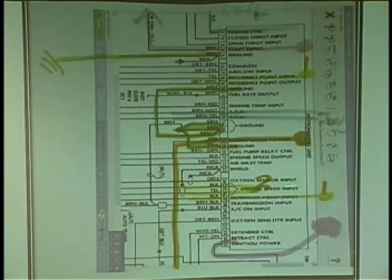Now if you wanted to, you could also highlight the crank sensor and cam sensor. I use yellow for any type of sensors, and I use blue for driver circuits. But look at this. Now that I know where all these wires are, I pull them out of the harness. I just put a piece of paper there just to show you. Look, now with all these other wires laying around, I'm going to check battery feed, which I had, just with a test light.